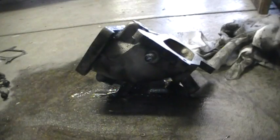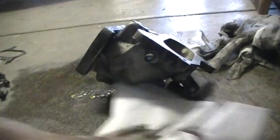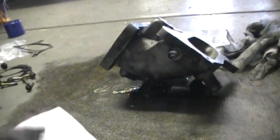You can see here, if you look, here's the EGR, and then there's two ports down here. These are what get blocked. That's one of the problems. The other problem is that DPFE sensor. And the other problem is me having to reach clear over this camera to do my work.